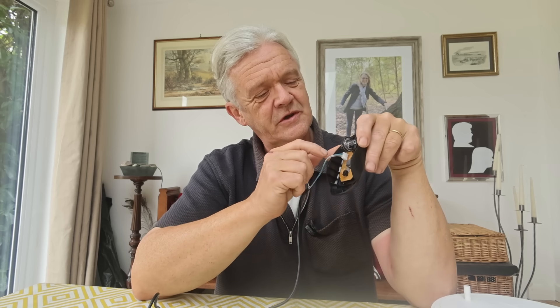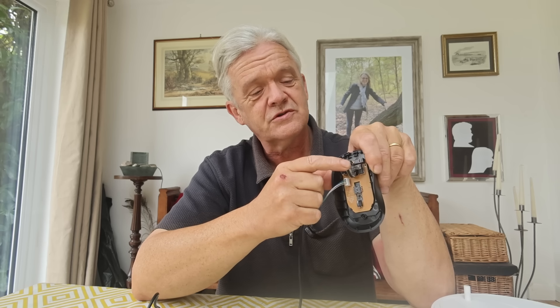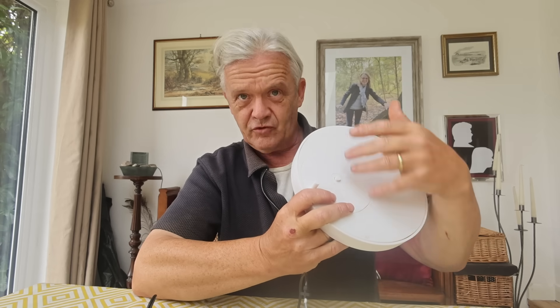We need a home point, and these mice come with three switches — one here, one here, and one under the scroll wheel. There's also a resistor for the scroll wheel sensor. We wouldn't leave the switches in their original positions — you just desolder them and solder a micro switch wherever you want the home position to be. It will zip to the home position, hit the micro switch, set to zero, and then as the printhead moves, it adds the position changes together to create an absolute position. So we've created a position sensor, and I want to incorporate it into this design — which means doing the 3D design and print for it.